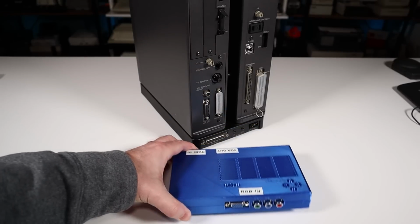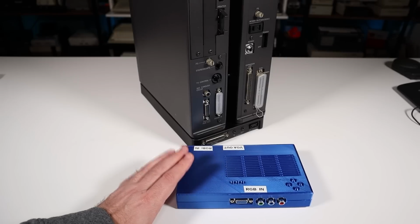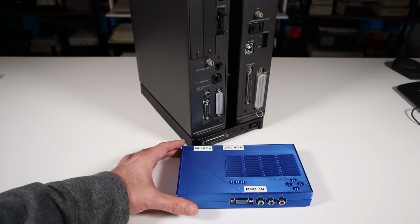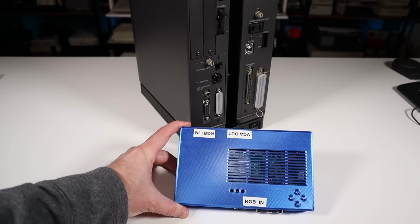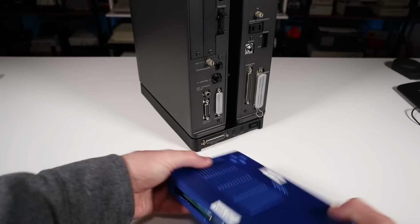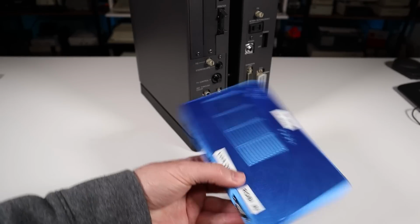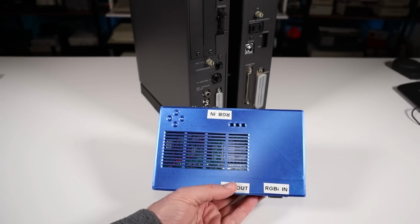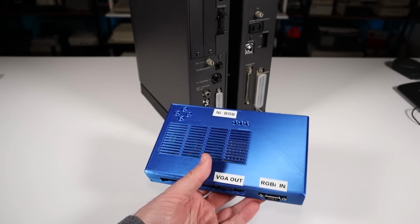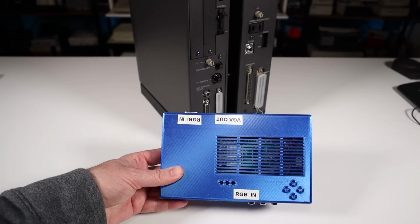So what I've done is I've built this, and this is called the GBS-Control, and it's a project that allows you to take a $20 commodity upscaler, the GBS-8200 upscaler, pair it with an ESP8266 Wi-Fi microcontroller running new firmware that acts as the new brain for the upscaler chip, and you get a Wi-Fi connected high-powered RGB upscaler for less than $30. And I just 3D printed this case and I stuck all the parts in there. There's a little soldering involved, and I've also integrated a CGA to RGB into the design as well. So this will work with EGA, CGA, and Commodore 128 RGB graphics as well. So analog and digital RGB to VGA for about $30. And I hope this works with the X68000.